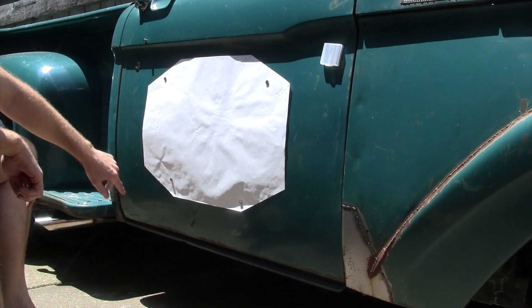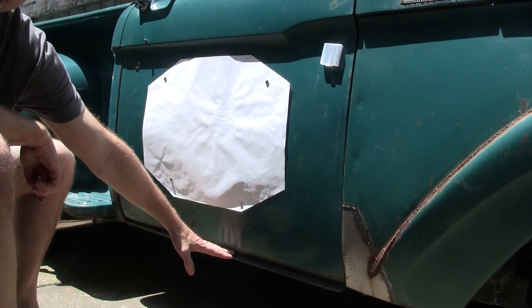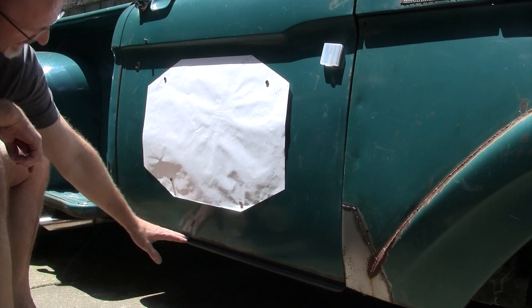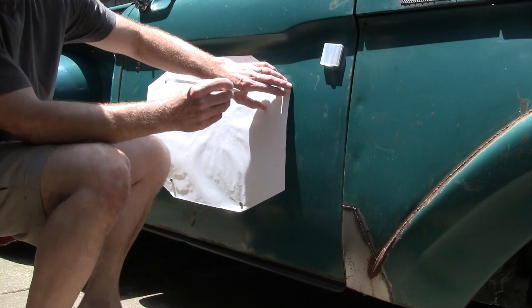From the bottom of the logo down to the bottom of the door — this body line right here is not parallel to the bottom of the door; this line kind of comes down from the fender hood and then it kind of rises as it goes back. So if you make it parallel with that then your logo is not going to be centered with the bottom of the door. I've got it basically even on both ends from the bottom of the door. I've got a little Stabilo pencil here — just a little erasable pencil — and I'm going to make a mark at each corner so I can take this off and put my marking tape on.